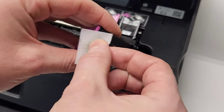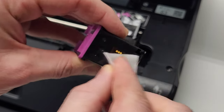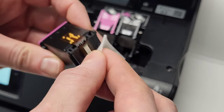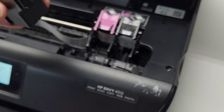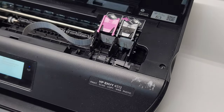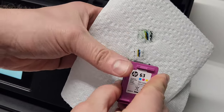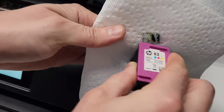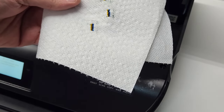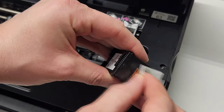In the meantime, we'll clean the cartridge — especially the one that has given us the error. Just gently wipe this area and the area where the nozzles are. You can also clean with the same swab and tap on a paper towel. It seems like the color is correct here — it's giving us a proper stamp of three colors and they all seem to be good. We'll do the same thing with the black cartridge.